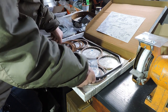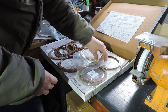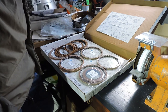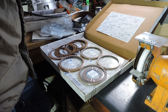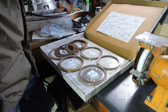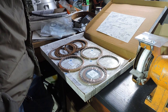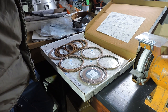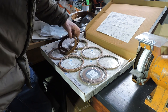Here's the gasket for your oil pan. The most interesting part is of course the clutch plates. Some of you may wonder where the steels are — since I dismantled a fully working transmission without any issues and didn't see any strange markings on the steels, I'm going to reuse them. If you buy a transmission from a breaker yard with no history, I'd recommend getting new steels. If the transmission was functioning without major issues, reusing the steels is fine.